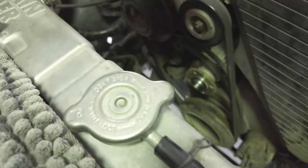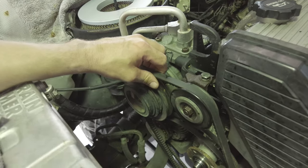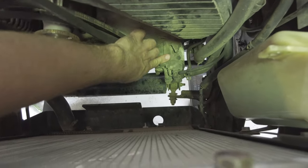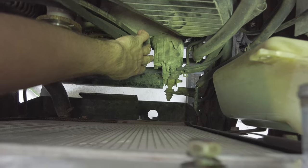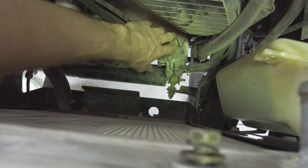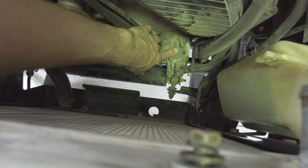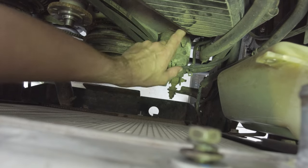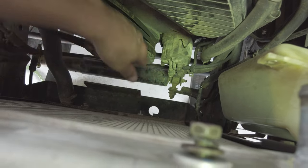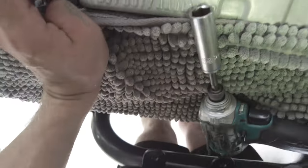So I'll pull that off, get the AC compressor out of the way. Then we've got to get this cover off and have a look at the timing belt. Oh, down here is, I think, the vacuum pump. And I've got a little bit of a leak coming from that, an oil leak. So while it's all apart, I'll probably pull that off, reseal it up and put him back on. And this is my alloy radiator, Terrain Tamer. Supposedly stops your Troopy overheating.